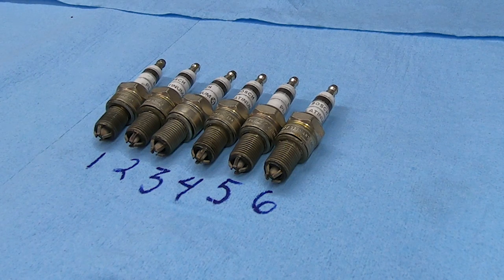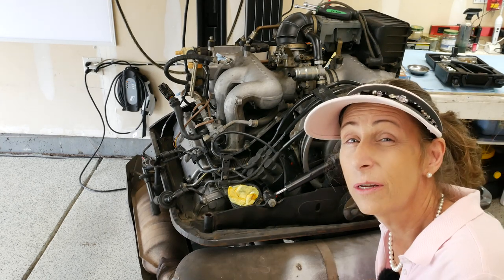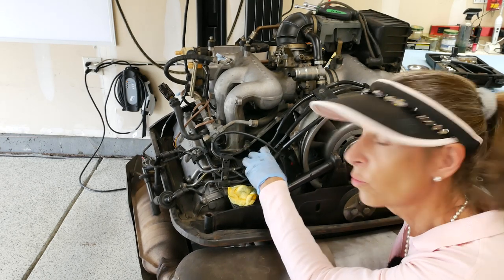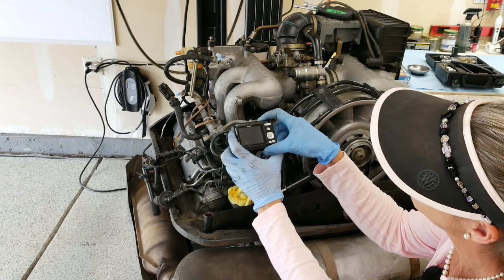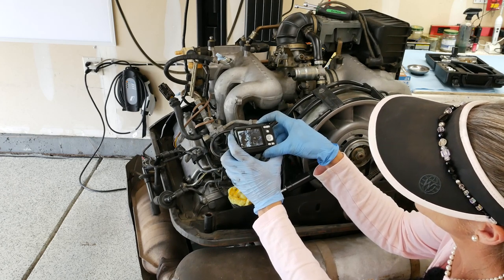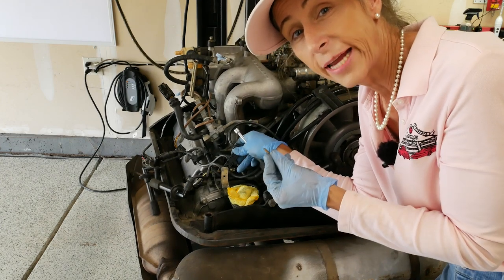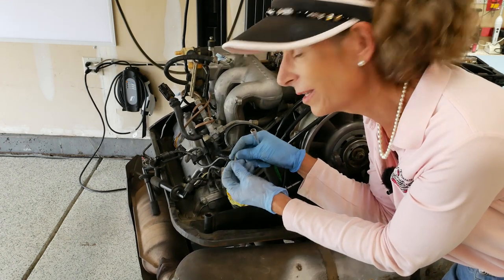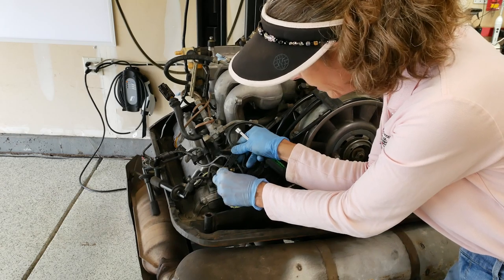These plugs all look really good and, more importantly, very consistent. Let's move on to the leak down test. With the spark plugs removed and since we're tearing all this down anyway, now is a good time to take the spark plug wires off, because our next step is to get the distributor cap off so we can see where our crankshaft is. Take some pictures to make sure I don't forget how everything was mounted. I like to put the bolts right back into the bracket they came from — that guarantees they stay together.